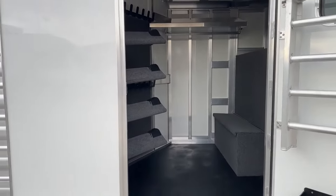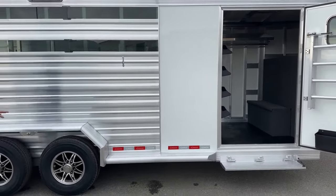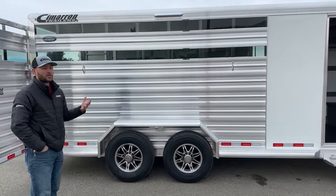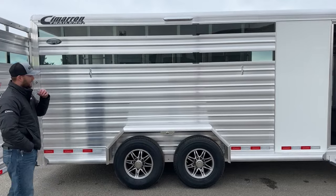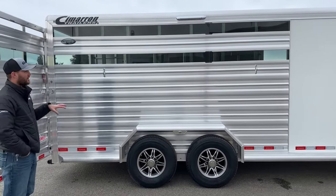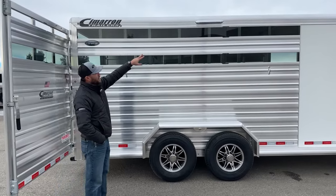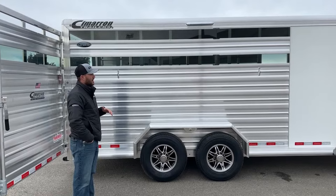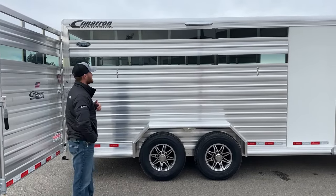Working our way down this passenger side, we are going to run full extrusions on this passenger side. Your full extrusion runs anywhere there's stall space, because that's kind of where you're tying your horses. This extrusion is quite a bit more beefy than our painted sheets, so we like to do that anywhere a horse can lean, paw, or kick — just to add some strength to that trailer and keep it looking nice. Up high, we have a 16-inch awning light casting good light over here for saddling and tying horses out, and it gives enough light from that tack room to saddle horses on this side.